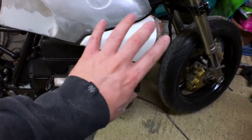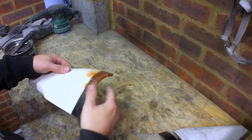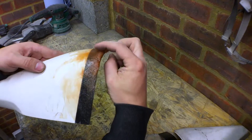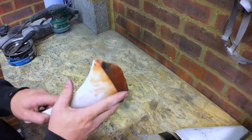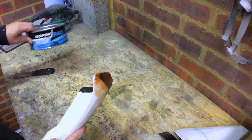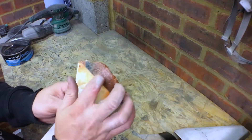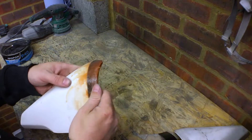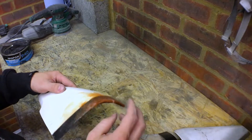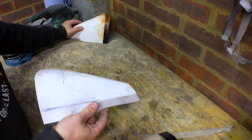That kind of matches in — when the forks come around, nothing touches, so that's good. I'm going to put a little bit more filler on this, try and tidy it up, and see how that looks. So that's another layer of fiberglass filler on there, which just kind of brings that edge up nicely. While I've been waiting for that to dry — this stuff dries in about 15-20 minutes and is hard enough to sand within half an hour, so it's really good for this.